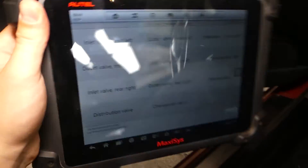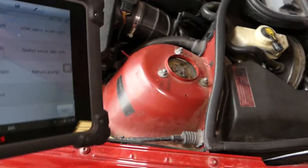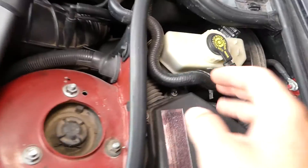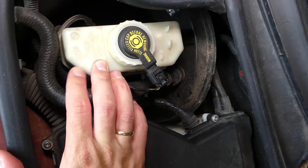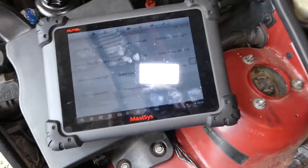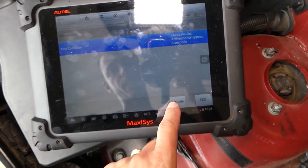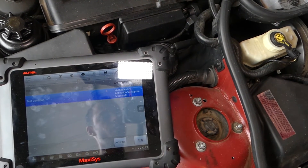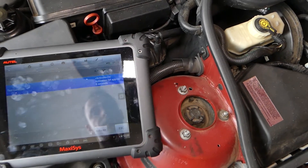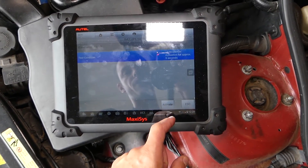This being a wireless computer, it's pretty handy — because you can go under the hood and activate the pump and listen and be able to hear it. On this BMW, some of them are super hard to reach. It's under the brake pump right here and you have your ABS pump all the way down in that hole — almost impossible to stick the camera and show you where it's located. If I click Return Pump, that's your ABS pump — we can activate it for about five seconds. Listen now. We can definitely hear our pump going. You can actually test valves and all that stuff as well.